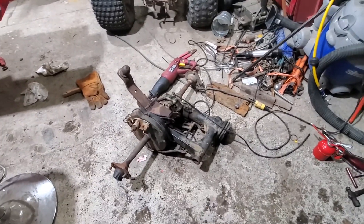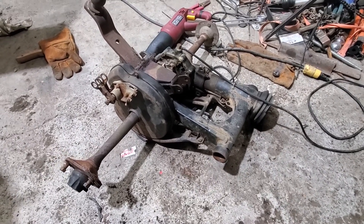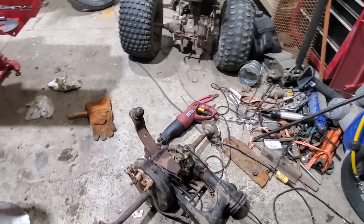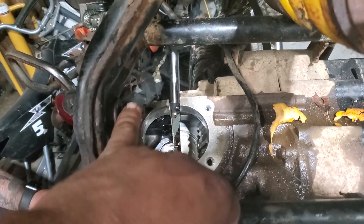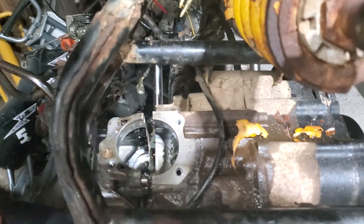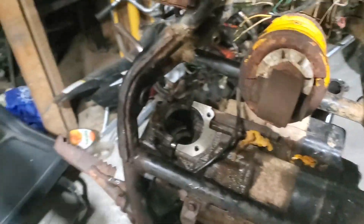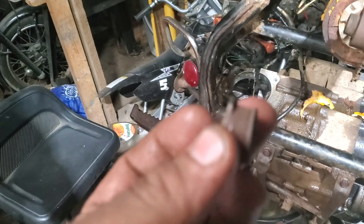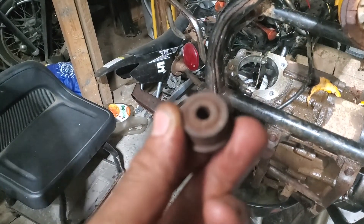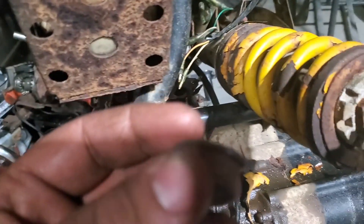This is the rear end for the 225 DR - we got it disconnected, and it was not a fun job. We got out the sawzall, the grinder, we had to pull out the torches. We ended up cutting this side here - the shaft that comes in - and the bearing race were frozen and rusted fast on both of them. We ended up cutting here and the whole swing arm came out. This is the bearing race and part of the shaft, and this is the one we cut off with the sawzall and the grinding wheel.